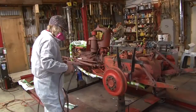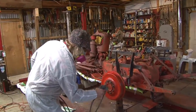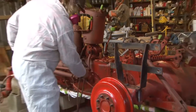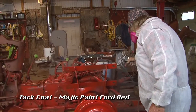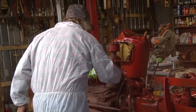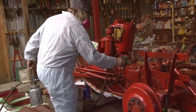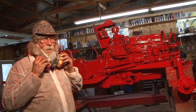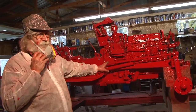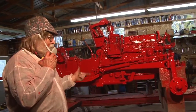You're ready to paint, man. You want to do a tack coat — a very light tack coat — and then come back over with a light coat. We got our first light coat on there, and you can see how this paint covers. Normally putting paint on like this, you've got to put four or five coats on to get it up to this kind of a gloss and this kind of coverage. But you can see right now that this stuff really goes a long ways. We got our first light coat on there.